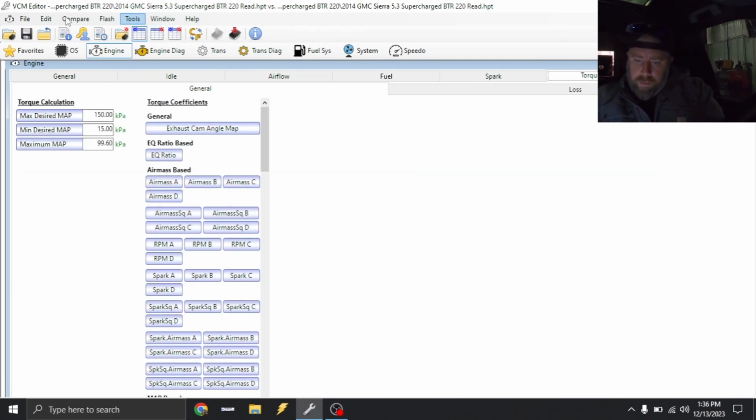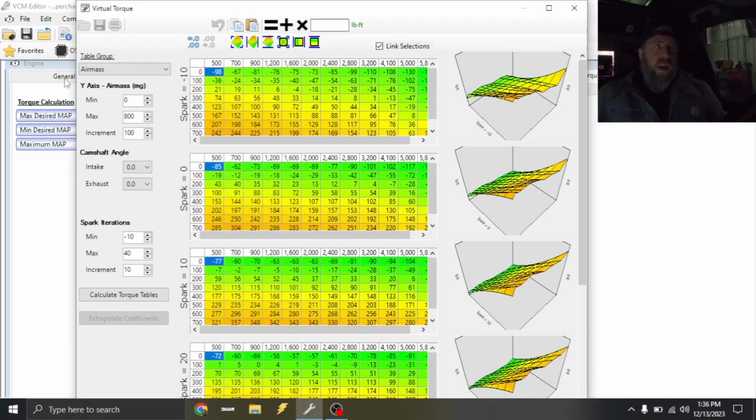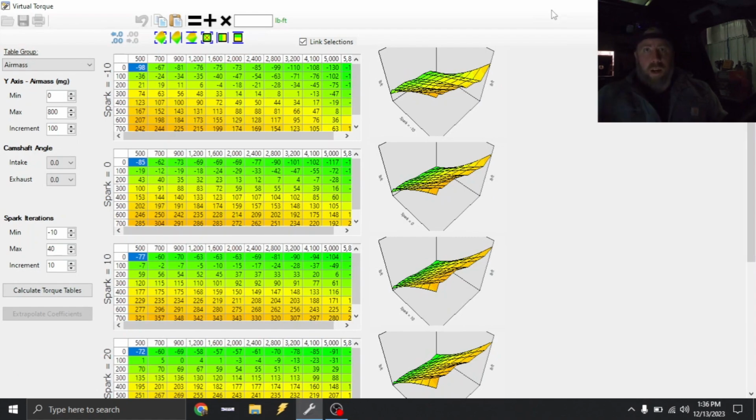We're gonna go in the torque model. And as I've showed you guys before, when it comes to these camshafts, they are definitely gonna need an adjustment for torque. So for now, we'll do a 20% reduction in our torque model, and then I will dial it in using 0 pedal torque later. In order to reduce a negative number, you have to multiply it by a positive number. So we're gonna do 1.2, and that's gonna lower it down 20%.